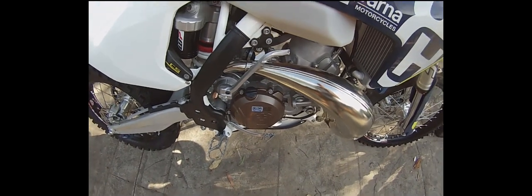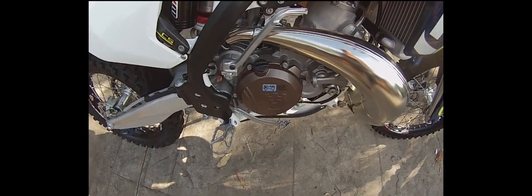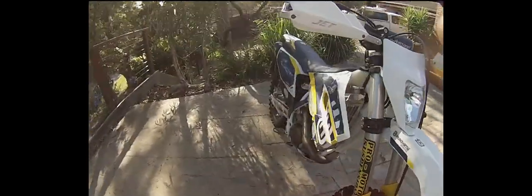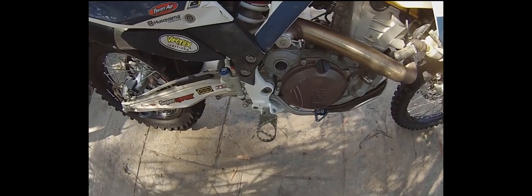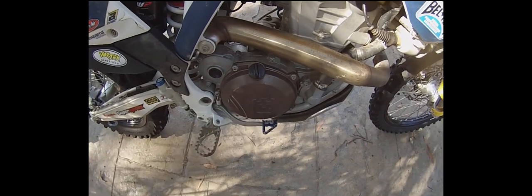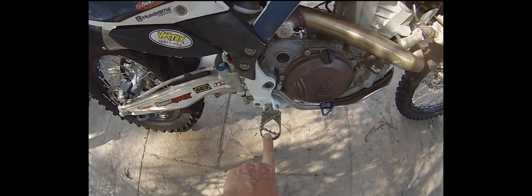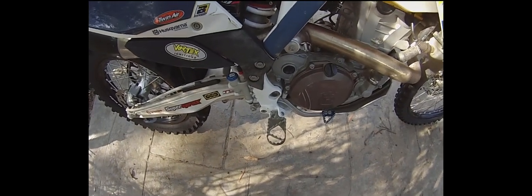That's pretty neat — only a small detail change. I did find on my earlier TE 316 model that the rear brake was quite touchy, even more so than the FE 350. I'm hoping that touchiness may be alleviated by the slightly longer brake lever. This is an aftermarket tip as you can see, but it does have a chamfer being an aftermarket part — the original brake pedal had quite sharp teeth, which is prone to hurt you if you're unlucky enough to fall on a rock. This is the old footpeg as well; you can see it has more of a serrated design. It might have changed, but we'll see what happens when you ride. I imagine the grip levels are probably very similar — like most things, it's not revolution, it's evolution.